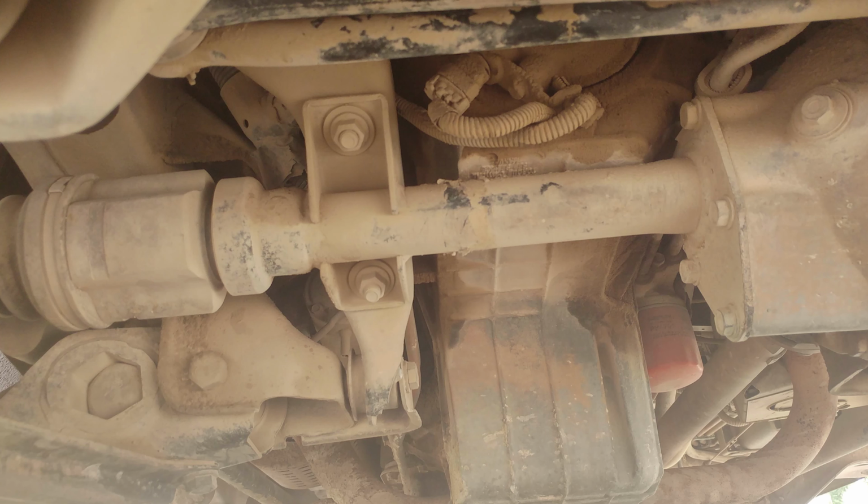But you can, especially if you have an all-wheel drive van, look at where your oil pan is sitting in relation to your front differential and your front axle. Mine actually isn't resting on the axle, so I'm hopeful that it's going to be pretty good, but there's very, very little clearance. So as that engine is moving around and rocking around and bouncing around in there, it is actually making contact with the axle and starting to wear on the oil pan, which is a very, very bad thing. You don't want that to be happening.